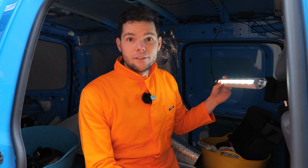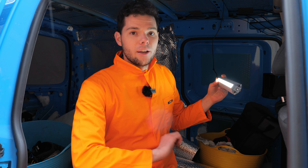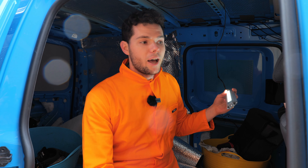The benefits of having a battery isolator: if you're working in the back of the van with your lights on, even in a work van where you go in and out all day long, you're not going to get to the end of the day and find your battery flat. You can have your lights running all the time. If you go away camping, you can have lights on inside the van and run different elements off the battery. It's not going to run forever — it's just a safety measure.